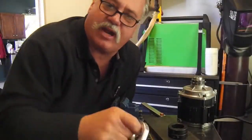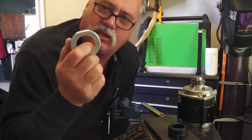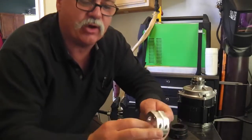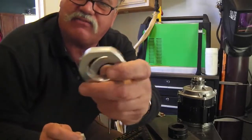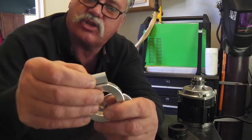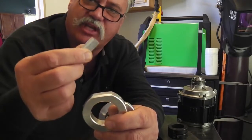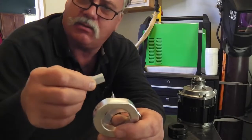So, okay, Christian Livingstone here, and I've got those aluminum collars, and I'm getting ready to weld them up. But before I do that, I just want to show you how I've prepped them. You can see I've left about a 1-inch flat spot for these little barrels to go on top of. These came right off the existing mount from the Cyclone motor, but we're not using it.